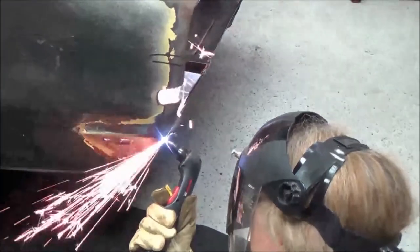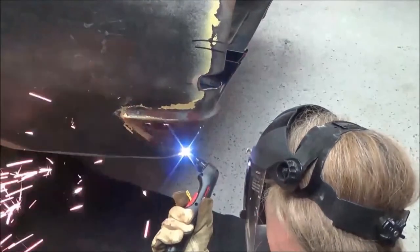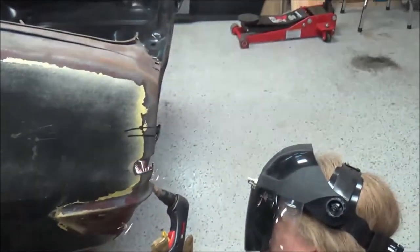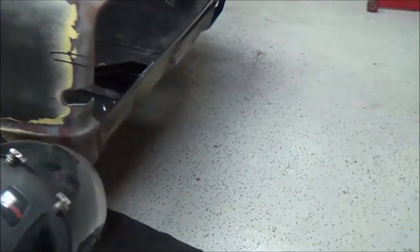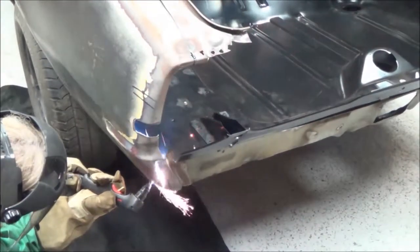Because of the way the GMF body is put together, I only tack in the trunk floor. This will hold together the back end of the car while I remove the quarters and replace them one quarter panel at a time. Once the quarters and the tail light panel are all tacked into place and adjusted where they need to be, that's when I'll weld everything up nice and solid.